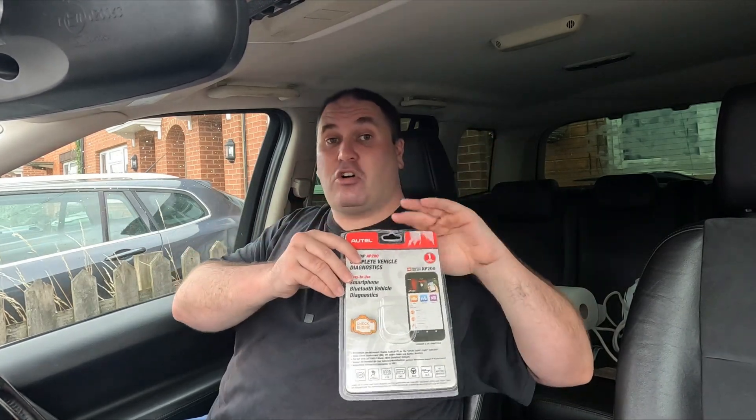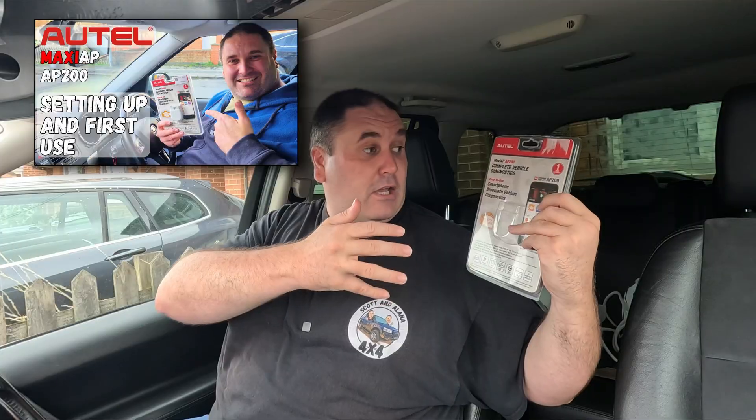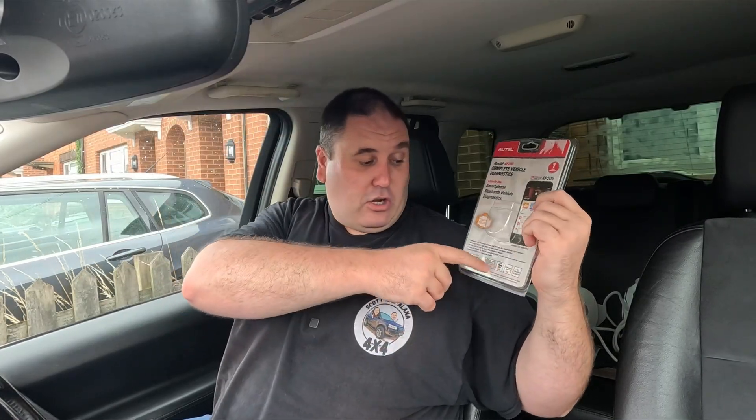So what is the outcome of all this? Well, the cheap dongle is decent if you have a warning light on your dash — it will read it and give you some basic information to get you started. If you don't have any form of OBD2 scanner, a cheap one will get you by. But in reality, get something decent like the Autel AP200. It's not too advanced or too technical — it is a bit cumbersome to set up, which is why I did a setup video on our channel. Once you've got it set up, it reads codes and has a load of extra functions: it can reset airbag lights, do DPF regens, reset service lights, and all manner of different things.